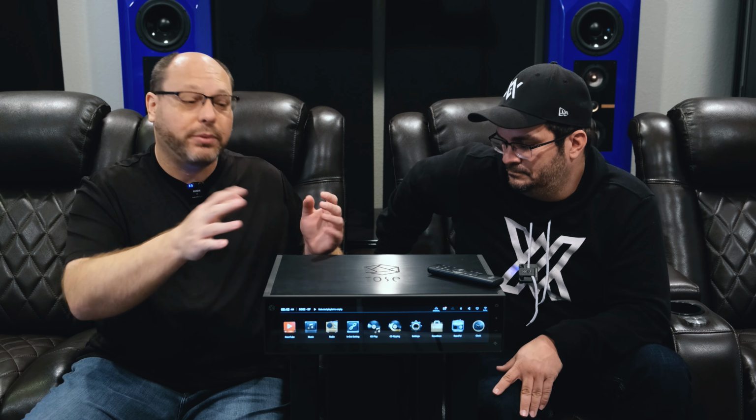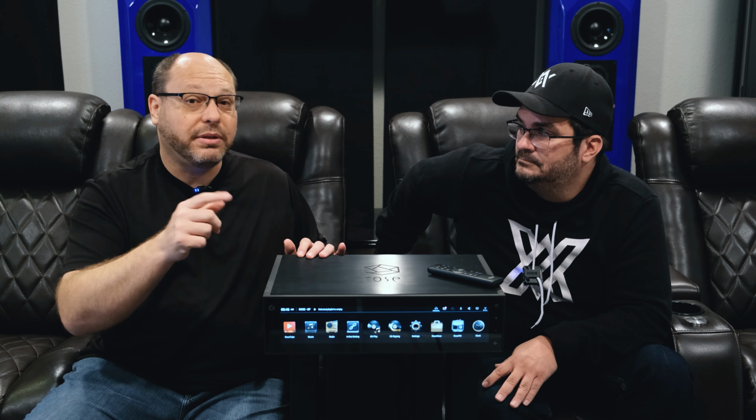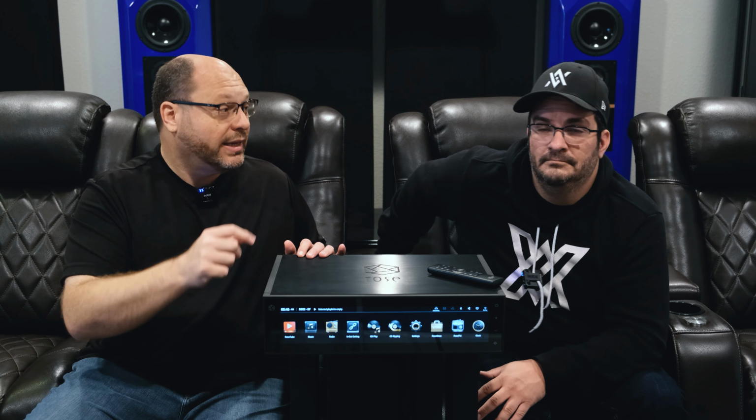Now, this also has other features that are really interesting. I mean, there's no way that I can cover everything that this does in one video. I really encourage anyone that's interested in this to go to the website and check it out, because there'll be a full list there. But this also can have a USB attached CD player, and you can use that as a CD transport. Now, if you want to just do CD transport, you can do optical in, you can do coax, or any of the other ways, and use the DACs in here. And in most cases, the DACs here will be better unless you're into a really high-end CD player. However, if you want to rip your music, this does it for you. I believe the limitation there, though, is that it has to be a USB attached CD player.